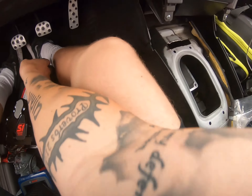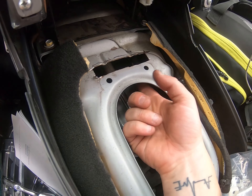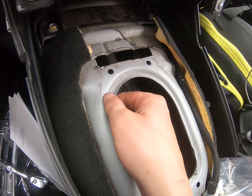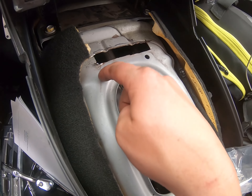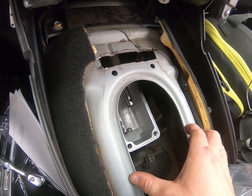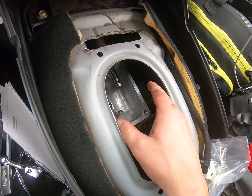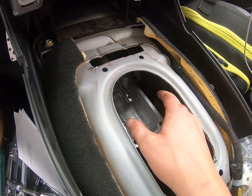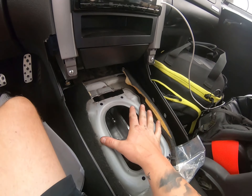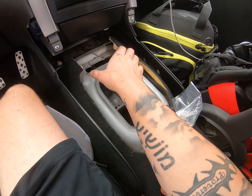What I'm going to have to do is cut out this little section right here where that plate was, and then it should slide right in. I should still be able to fit it within this section. So for any of you guys wanting to do this, you will have to do that in your street car. I guess you could create a little metal plate to block it off if you're worried about it, but the shifter looks like it still maintains the factory shift position so you can still fit the boot on.